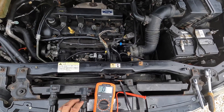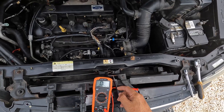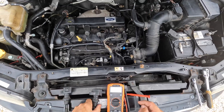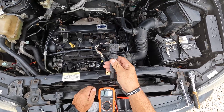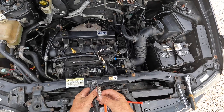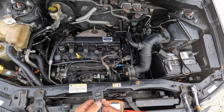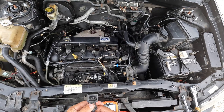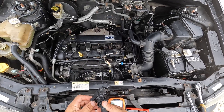I was unable to check what amperage went through because I know it's definitely more than 10 amps and this would blow my multimeter. By powers of deduction, I managed to isolate it to this coil pack. It's confirmed it's not the ECU. The spark plug was particularly carbonized, and it had been running a bit rough, then really rough on the day, and then it just stopped. Changed all the plugs, reset everything, and it went — maybe I disturbed something, or maybe it was just on its way out and that was its final gasp.